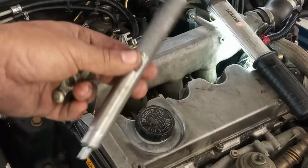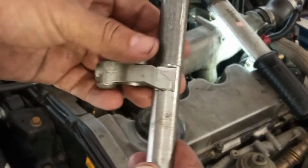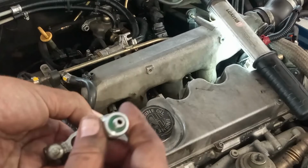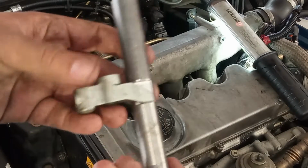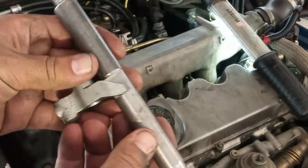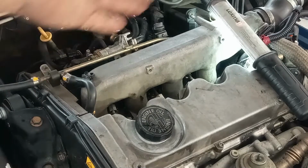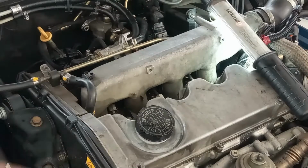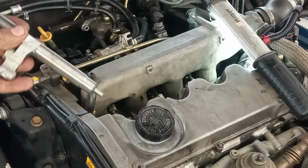Now I do have here a false injector that I ordered a machinist to do. It is the same size as the original injector, but it has a hole straight through, so the gauge goes on there, okay? So I'll put one at a time, 1 through 4 or 4 through 1, does not matter, and see finally what is the compression of this engine. Meanwhile, I did here a cleanup of the cavities, as you saw on other videos about injectors on my channel, okay? So let's go.